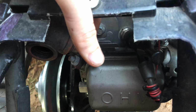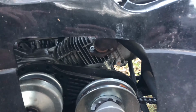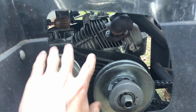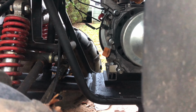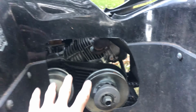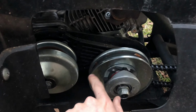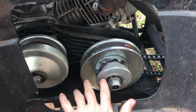If you want to take this out, I gotta move the entire motor. So that kind of sucks. And you're probably like, well, why don't you lower the motor? It's because of this torque converter here, the way it's angled. I had to put these 1-inch spacers up there in that steel plate to jack it up for that thing there to just clear, so I can just slide the whole thing in there and run it right there. Everything in here is pretty much a tight squeeze. I know you're also asking, well, why don't you just cut this part out, drop the motor back down, have the torque converter down there.